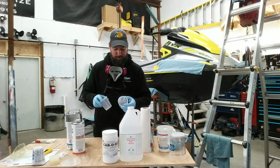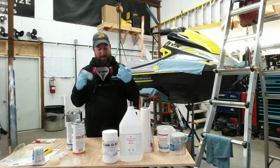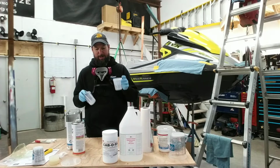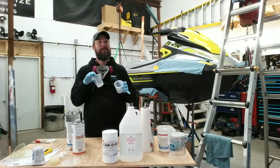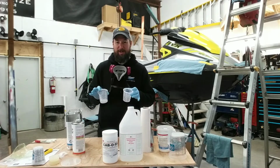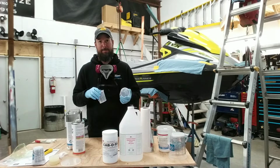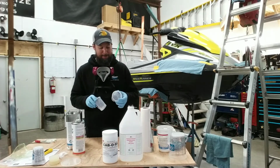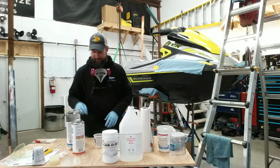So anyways, I'm going to pour this out, then put my mask on, and start mixing in some Cabosil. We're going to look for a mayonnaise consistency, maybe a little bit thicker than that, but somewhere in and around there. We don't want it to droop out. I don't want to sit here all night and babysit it until it sets up. So we're going to get to a happy medium, and give her heck.